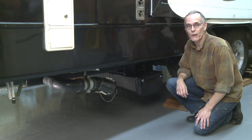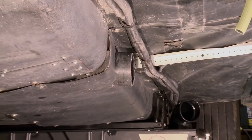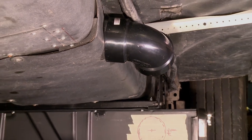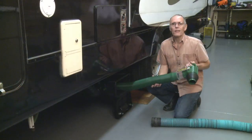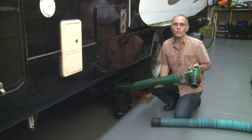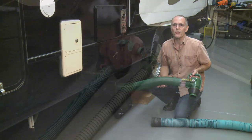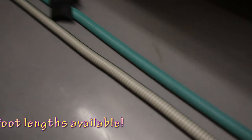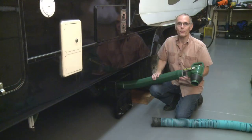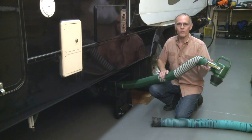So now I've got the storage box mounted. The last step is to rearrange the sewer pipe to line up with a hole I'll cut inside the storage box where our Wastemaster hose will connect. A big part of this entire kit is the new hose, which now has a 4-to-1 collapse ratio instead of the old 3-to-1. Check out the difference in length between the old and the new — that's important because it allows you to access more of those not-so-conveniently located dump points. Another feature of the new hose is that it snaps into place and stays there as you expand or bend the hose.